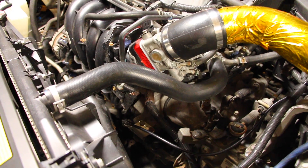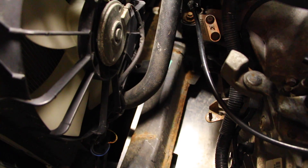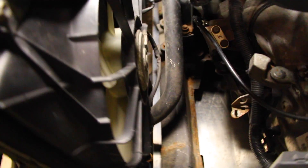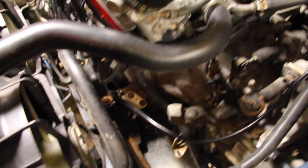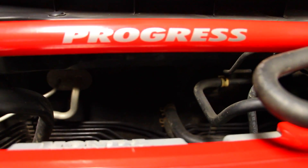I have the upper rad hose right there, I have the lower one right there that comes from the thermostat from the block down to the bottom side of the radiator. I've also got two additional ones attached right there — one and two — that run behind the engine through the firewall and into the heater core.